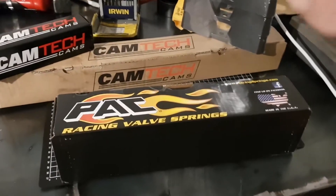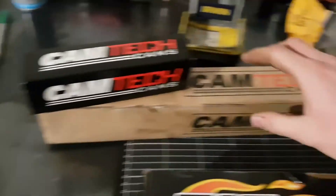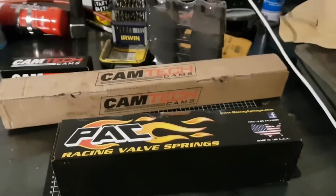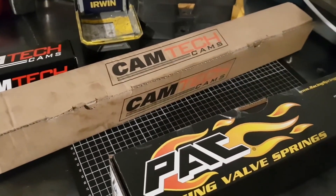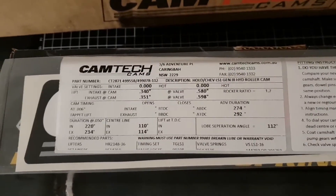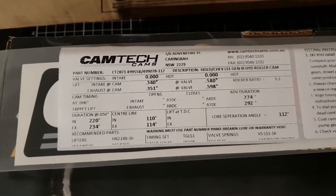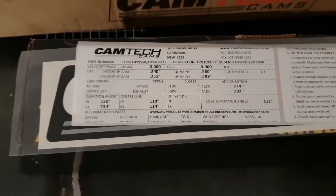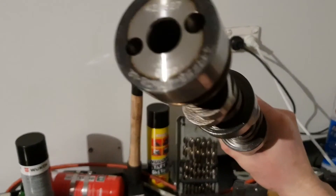Before I end the video, just show a few things we've got for the car. We've got some springs, cam, some lifters, and these little bucket things that hold the lifters. So hopefully make 270 to 300 kilowatt at the wheels with all these good bits. This is a cam card for all those wondering at home — it's not the biggest cam, you can run it without a stall converter, so that's what we wanted to do, make it a little easier on the street. Still pretty big though. And that's the cam — brand new, not a regrind.